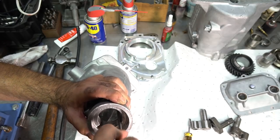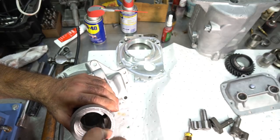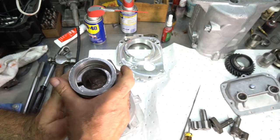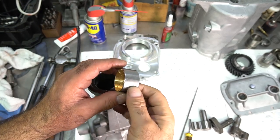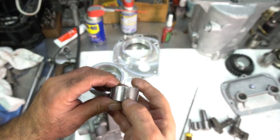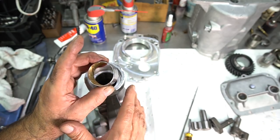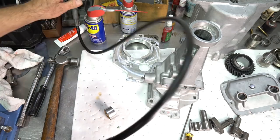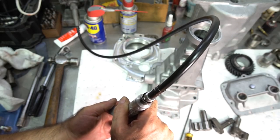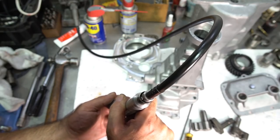In any transmission, make sure the yoke fits in the tail housing first, and that the yoke fits on the main shaft before you put both components together. I like using bronze dimpled bushings in my extension housings. The puzzle-lock joints are very rough, and if they're not smoothed they'll balloon the bushing inward and prevent your yoke from going in properly, so I'll take a rotary wheel and just smooth all that down — you just want to break those high spots.